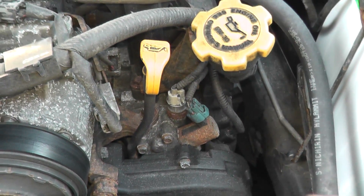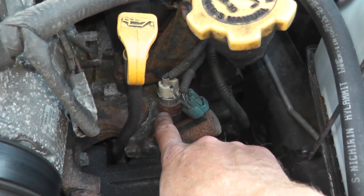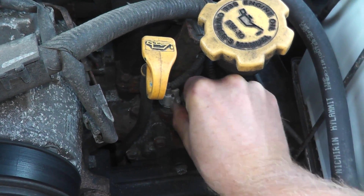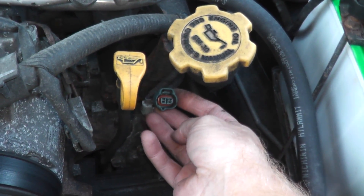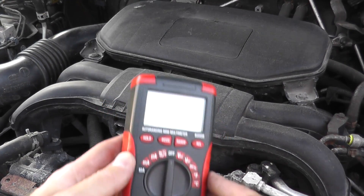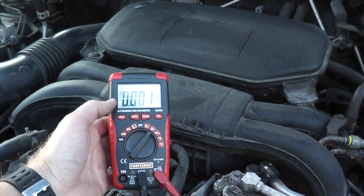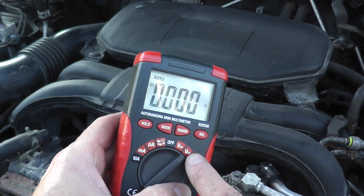Now to test it, two things. First, we want to verify that power is getting to the solenoid. Now this is an oil pressure switch — just for diagnosis only, we're not dealing with this. You want this one right here. There's a tab — press down the tab and pull up on the body. Don't pull on the wiring. Now I want to verify that power is getting to this harness connector. This is just a digital multimeter — do not be intimidated by these if you've never used one. Around $20 or so. You want the volts DC setting.